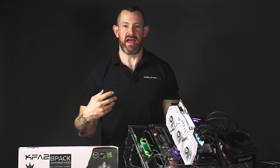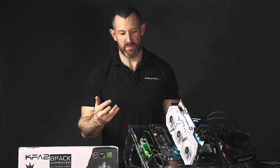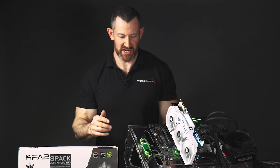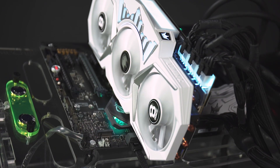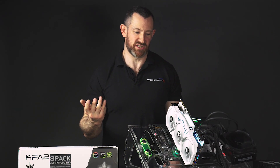This card is designed for the ultimate end gamer and the ultimate end benchmarker, or also the professional who wants crazy fast rendering and wants to gain a little bit more performance through overclocking. Now we've gone through the power delivery, let's check out the aesthetics and the cooler. The cooler is a three-slot design which means you can only fit two in any motherboard, so the most you can do with this is two-way SLI.